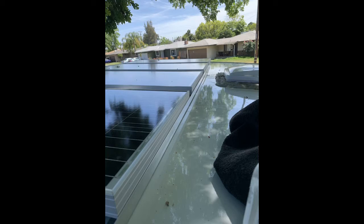I do not recommend flexible panels — they fail more easily, and there are still too many failures with flexible panels unless you have a reliable way to apply and replace them. I recommend rigid panels. I go with Renogy and have never had a problem — they produce basically what they're supposed to. And remember, if you get a 100-watt panel, don't expect to ever actually get 100 watts — that's under prime conditions.